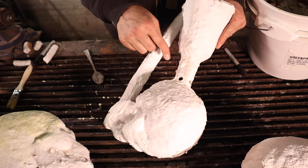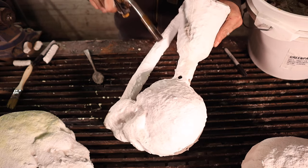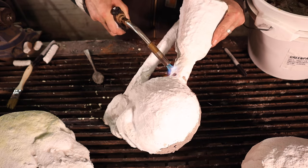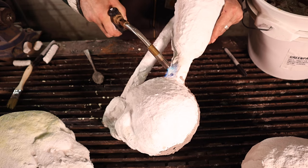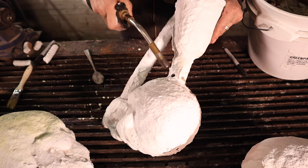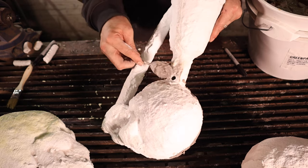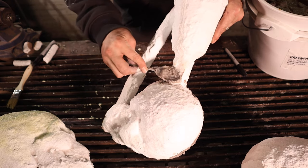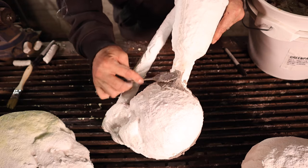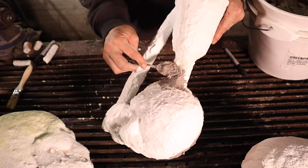When it comes to patching up the micro vents that I drilled, I'll come in with the torch again and cook it a little bit hotter, almost to the point where I see just a little bit of glowing orange around the edge of the hole. Then I'll come in with a nice little dollop, push it in so it enters the hole a little bit, but I don't want to push it so far in that it makes contact where the metal is. I'm trying to create just a nice plug, leaving it about a quarter inch thick right where the hole is, then feathering it out.